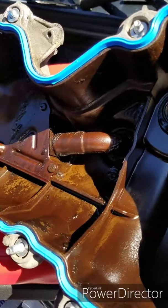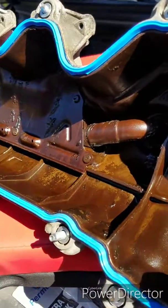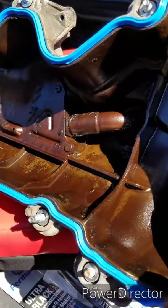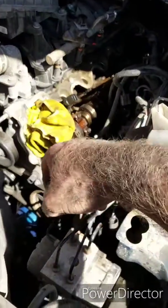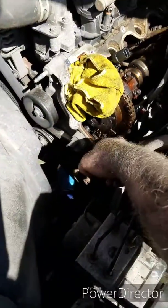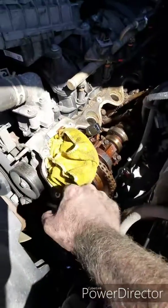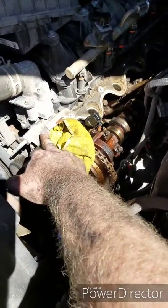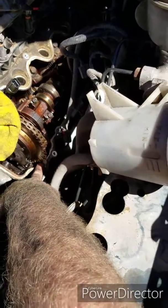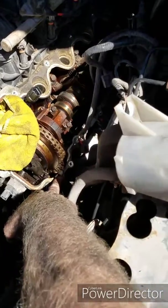Check out this cover - look at that gunk. I am going to try to clean this out as best I can before putting it back. You'll also need to put Permatex down here as well. I've already scraped up here - I didn't want anything to fall into the engine. I'll put a rag here, scrape down there, and then put new Permatex.